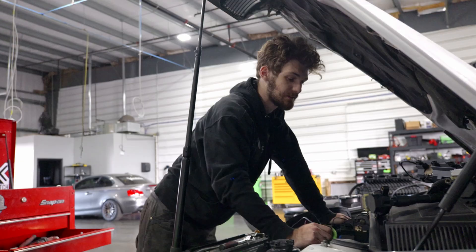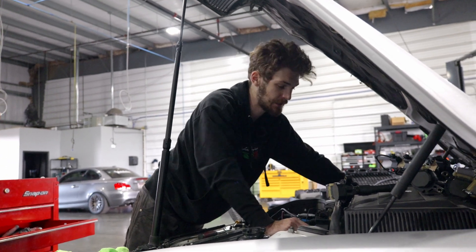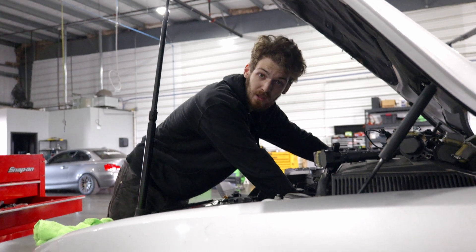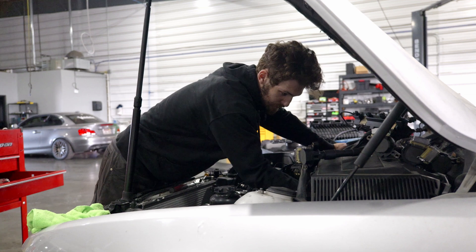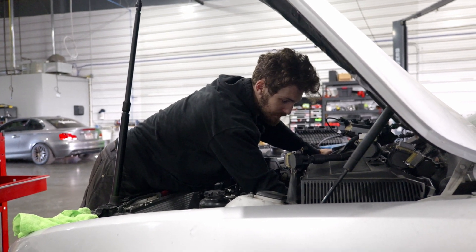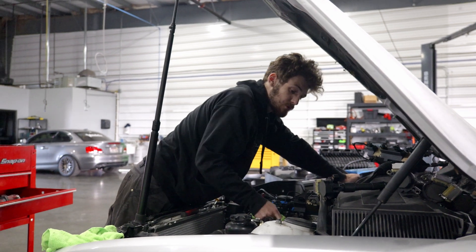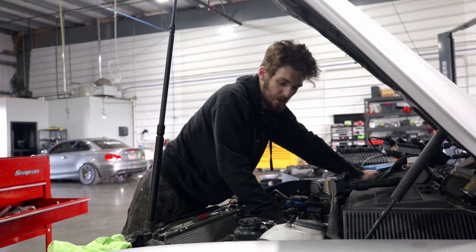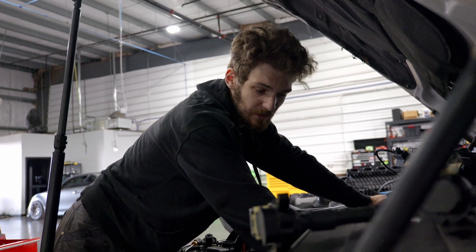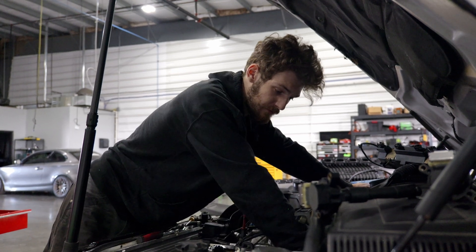The stock six-speeds for the WRXs don't shift great, don't feel great, and don't hold power — they're just like the stock five-speeds, basically glass. You start trying to dig launch them and you'll blow them up. I've got guys making 600 horsepower who dig launch from 5,000-6,000 RPM and bang flat-foot shifts through the gears, and the STI six-speeds take it. Those will hold 1,000 horsepower. IAG now has a synchro kit and a straight-cut gear kit for that trans, so you can push them pretty far. Out of all the Subaru transmissions, that's the one to go with — especially because they're pretty much identical through all the year ranges and they'll bolt up to everything. That's the really nice part about the way Subaru designed the platform: it's pretty modular.